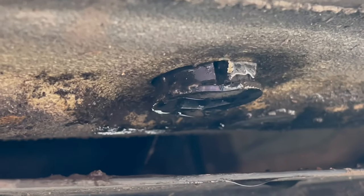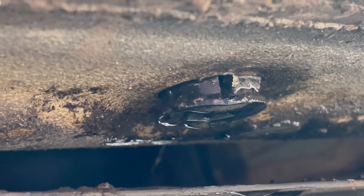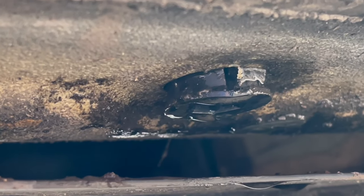The problem is that where this side skirt and the flap here sits, it actually blocks this release valve here, especially when it gets full of all that gunk. This piece, that's where the water is supposed to drain out from, and it's a bit of a pain and not the greatest design from BMW. The suggestion is to drill a hole through this piece here, so that water can run all the way through. Just what I'm gonna do now, but firstly, I need to actually remove this plug here,